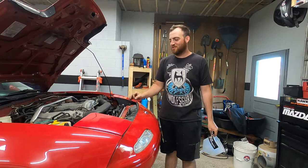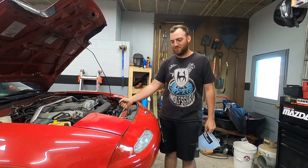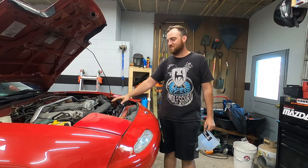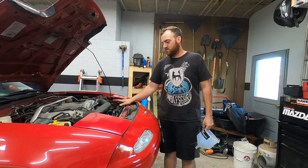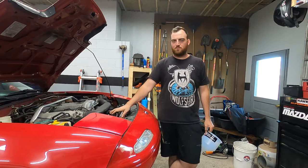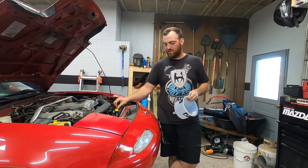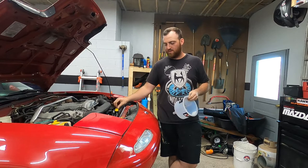Once everything's hooked up, it's time to fill it with coolant. This is the best time to make sure you've hooked everything up — there are really only two hoses you could screw up here. I've filled these before, gotten halfway through the jug, and all of a sudden heard dripping because a heater core connection wasn't tight. Make sure everything's tight: the drain bolt, upper hose, lower hose, any other hoses you touched. What I bought for the K Miata is this little fill funnel — you can get it on Amazon, I'll put the link in the description. It comes with a bunch of fittings that fit all sorts of different radiators.